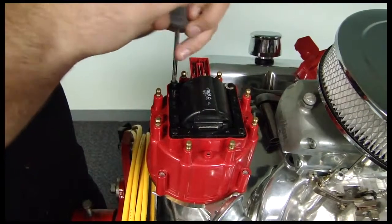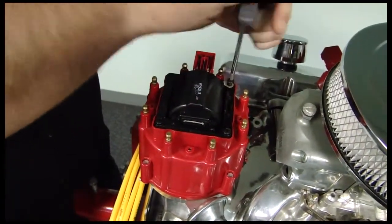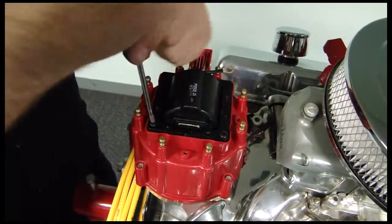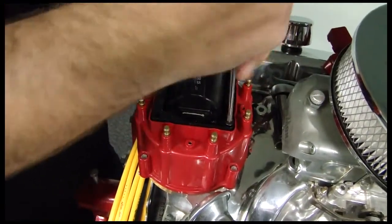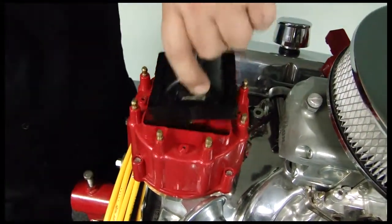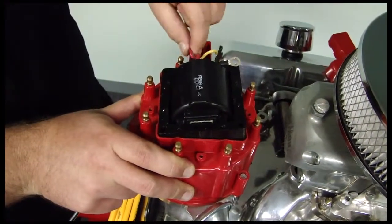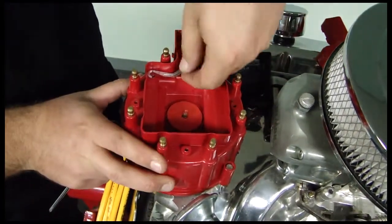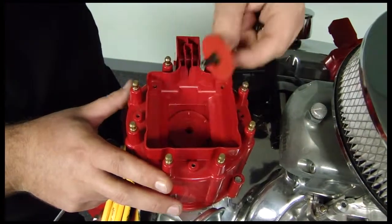And that's really easy to do. Pull these four screws out here. Make sure you remember where the ground strap goes. The coil pretty much lifts right up off of there. Pull your little flag connectors out here and your coil comes right out. You also have your ground strap that pulls right out or pushes out from underneath, however you want to do it. And there's a grommet and also your carbon brush.